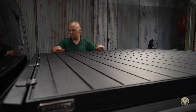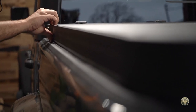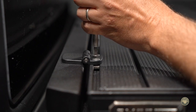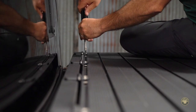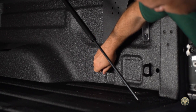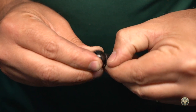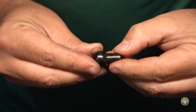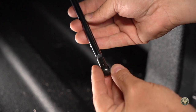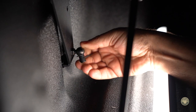Do final alignment adjustments. Tighten down the bolts to seven and a half foot-pounds or hand tight. Do not over tighten bolts. For ease of installation, remove the clevis from the mounted gas strut bracket. To do so, rotate the locking pin around the outside and then pull the pin straight out. Screw on the clevis to the gas strut. Repeat on the opposite side.